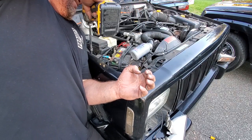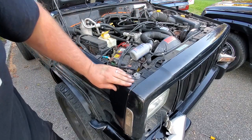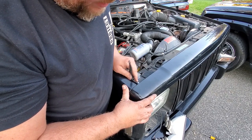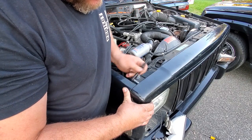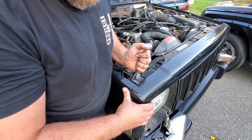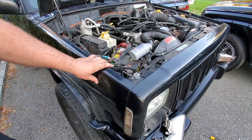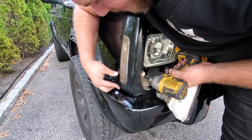One more up top — that'll keep it square. I'm still going to put a little pressure on it and pull the header panel with my hand while I tighten this. Perfect — that's a good alignment. And the same thing goes for the bottom: just apply some pressure, align the header panel where you need it, and send it on home.